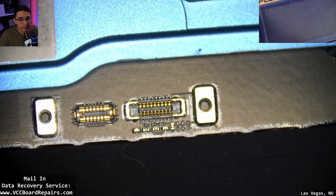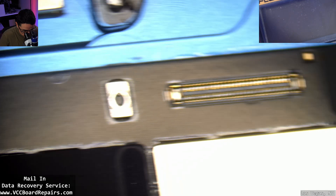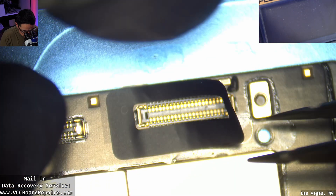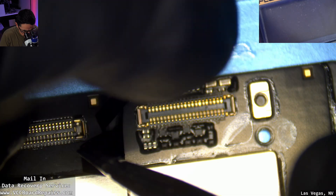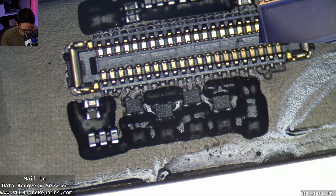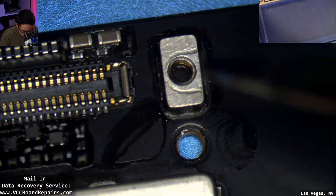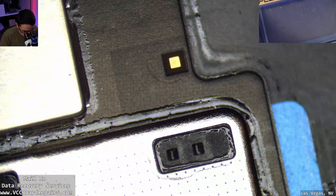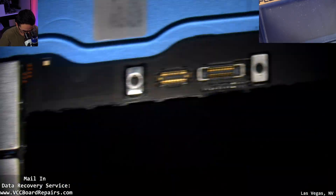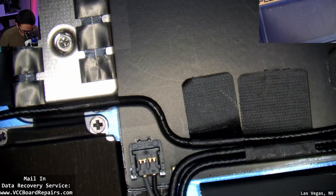Let's go ahead and lay this down to protect the LCD from any damage, then inspect the motherboard itself. We are potentially having backlight issues, so let's peel this up and see if there's any tool damage. It looks clean — I don't see any obvious damaged or blown components. Also check for long screw damage or any kind of tool damage around here. This all looks pretty clean.